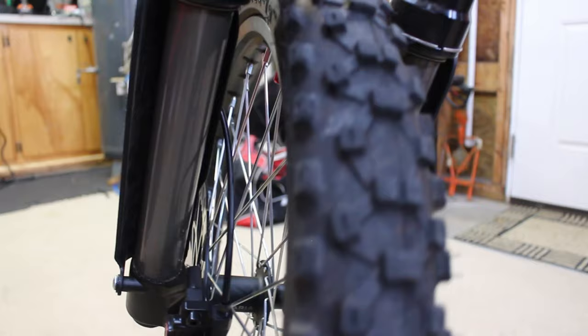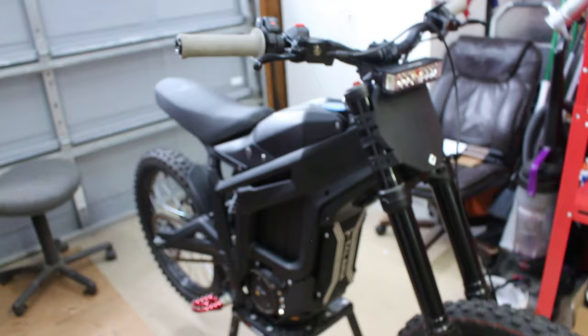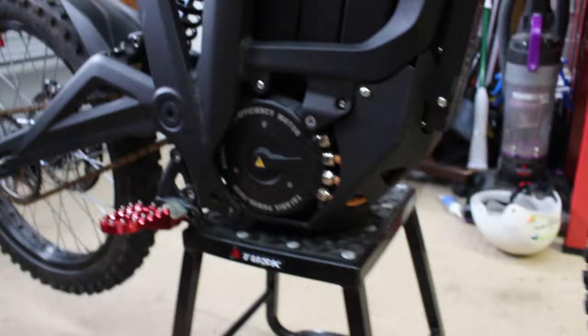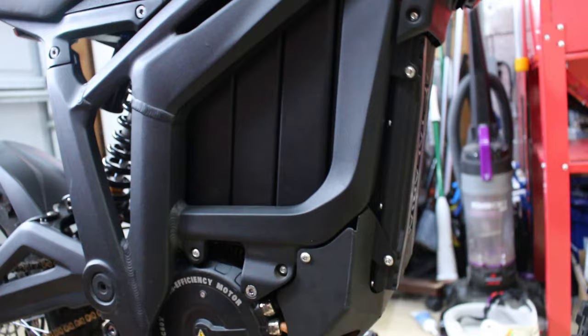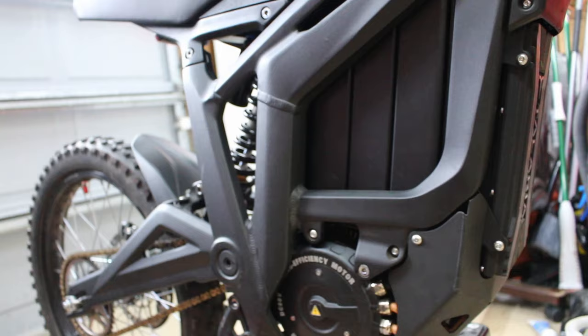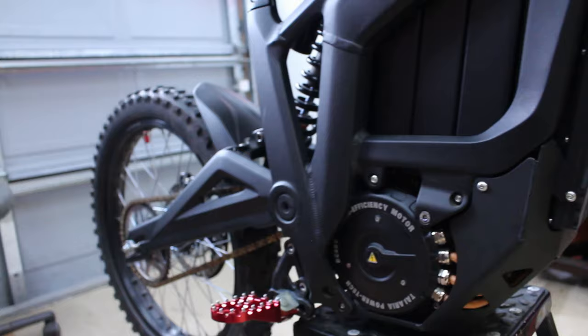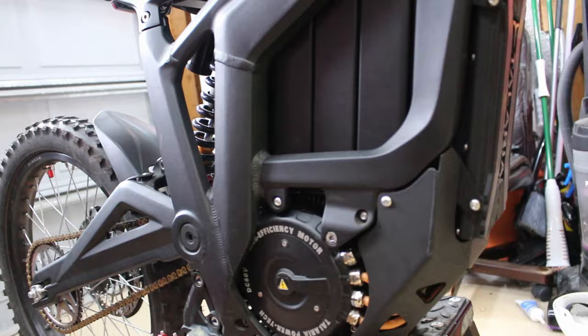The last thing I'll say about maintenance is to periodically give the bike a once-over. It's your life out there — you want to make sure you're safe. A lot of bolts from the factory come with a blue sharpie line on them, so you can go around and check by eye — as long as you haven't loosened them, those lines are a visual guide to see if any nuts or bolts have backed out. Check your front axle and tighten those pinch bolts, check your rear axle, your pegs — make sure the pins are still in — and inspect your chain, master link, and sprockets. Any part that could disrupt your ride, check it over and make sure it's still good.